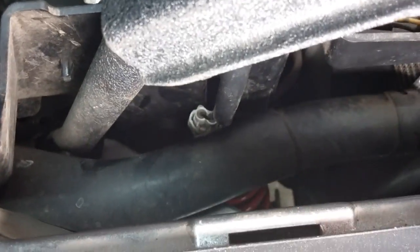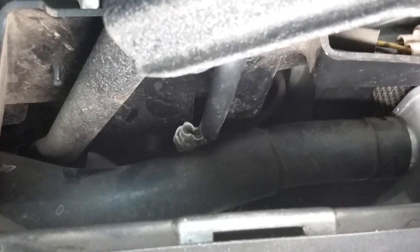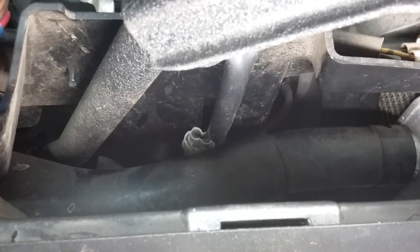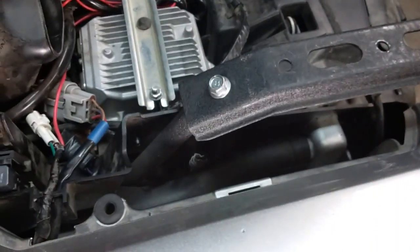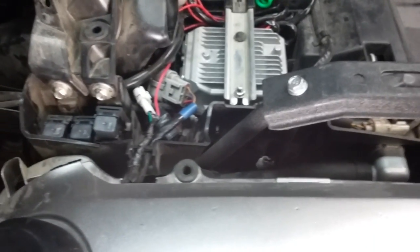After that, basically the first thing you'd want to try is the fan. What you'd really want to do is just look right down there, that white connector. It's not that difficult to get to actually. You reach down underneath the fender and over the top of the fender, and you can disconnect it with both hands. Then you can reach the bottom half, which goes directly to the fan. And you should try putting 12 volts DC to it. And obviously if the fan works, you know that's not the problem. But if you start testing everything and you don't know that the fan actually works, you're gonna be chasing your tail for quite some time. So I would recommend testing that.